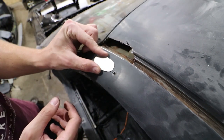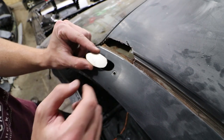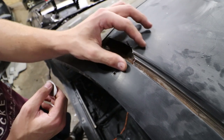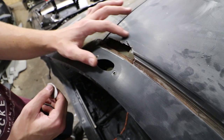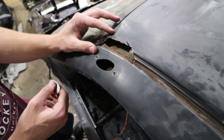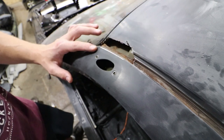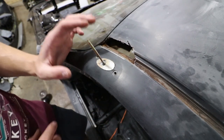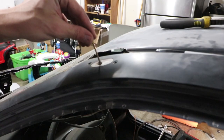I've been working ahead grinding a little piece to fit into this spot — it's still a bit bigger than the hole but I'll grind a little more off the edges and weld a bolt onto it to hold it in place. For this other section, I'm actually going to the junkyard tomorrow to cut out a proper replacement piece from another Honda, rather than fabricate something off the top of my head. I'll be careful around the structural points in this area, keep it controlled and neat — a weld bead here and here — so it's repaired properly. This top section just needs a bit more grinding and then it'll sit perfectly flush.